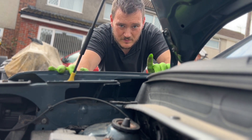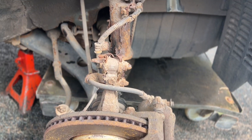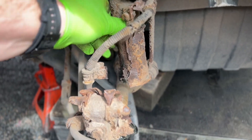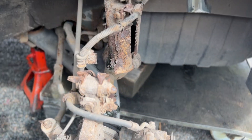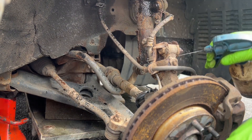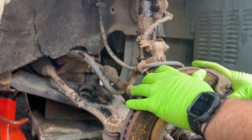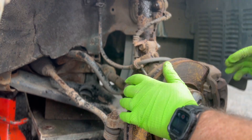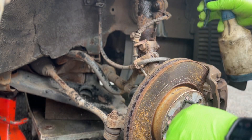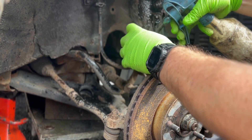Okay, so you probably noticed what the issue was, but if you didn't, you're about to find out now. That rotted away and snapped off. This is all a bit of a mess. Split the CV boot down here - hopefully the joints themselves haven't been damaged, just the boot that's split, it's ripped bits off. So yeah, we're going to clean this up as best as we can and hopefully save something.